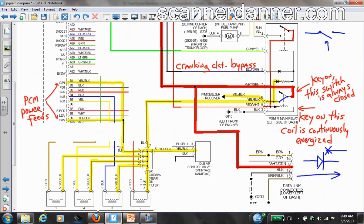This switch will be closed because we have power coming this way and a constant ground. So as soon as you turn the key on, we're making a magnetic field — it's a constant magnetic field on that bottom relay coil. That means the load side switch is constantly closed, which means the yellow circuit has constant power with the key on, engine cranking, or engine running. Key on: power to injectors, computer, idle air control valve, and immobilizer.